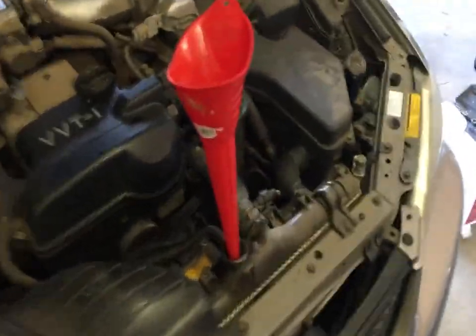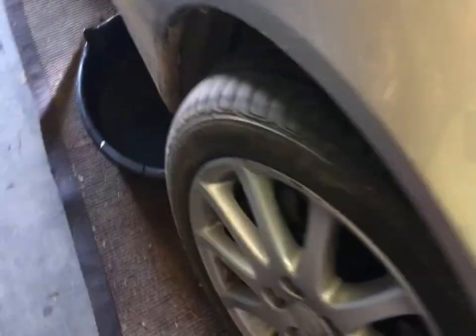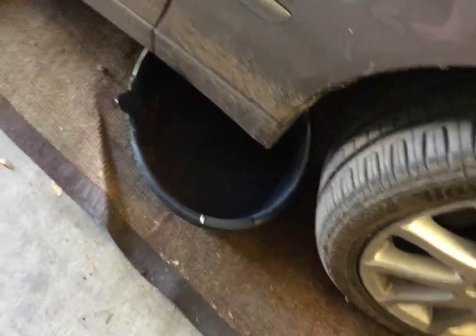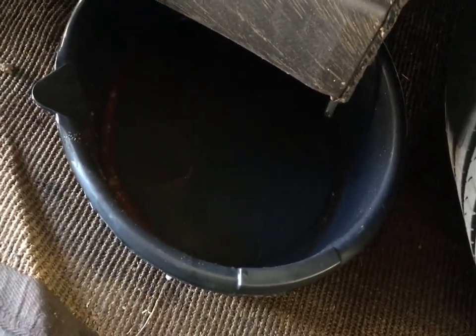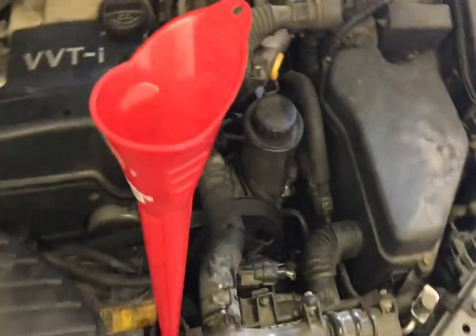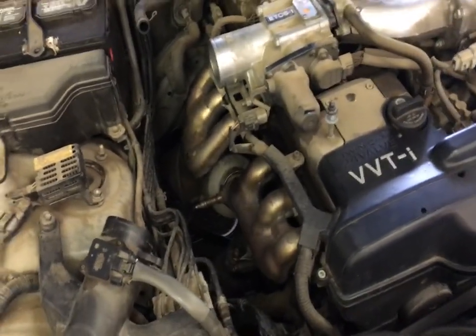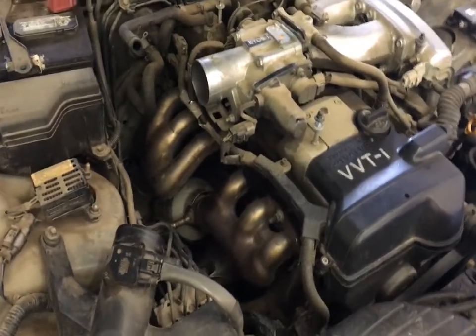With the help of our funnel, after we're done draining the heater core I disposed of that fluid in a different bucket. I keep this tube connected just to verify that it is still closed — I tightened it reasonably well but just double-checking. I went and filled the radiator with distilled water, got about two-thirds of this container, which should be right in order to fill everything up. So now what I need to do is put my air intake back in there, get everything connected, start up the engine, let her heat up for about 10 minutes at max heat, and we'll come back.